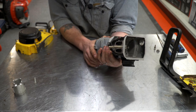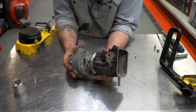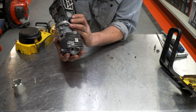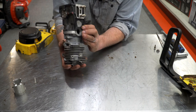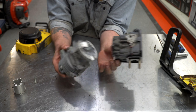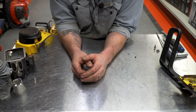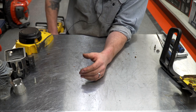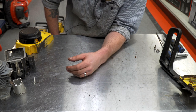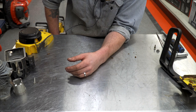Everything bolts to that, and that's basically what you're looking at. I think the big bearing might actually be on the flywheel side — I wonder why they went with a bigger bearing on the flywheel side than on the power takeoff side. Pretty ingenious design — they could make a really lightweight chainsaw for the day that was really super powerful. So what we're going to do is get this starter cover back on that saw. I don't have any wood here so I'm not really in a great place to cut, but we'll take it out and get it started up so you can get an idea of what one of these sounds like at idle and fully blasting out. They've got a pretty cool sound about them — something you definitely want to wear hearing protection with.